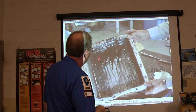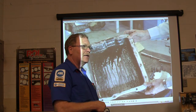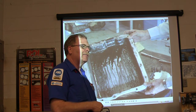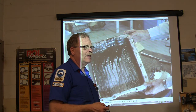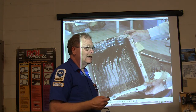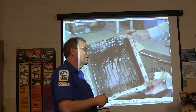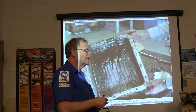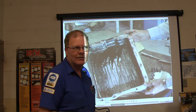This is what it looks like when you pull the transmission oil pan off and it's full of material. Whenever you see this, it's bad news. Some people say that if you service a transmission that's been driven 120,000 miles and never serviced, that brand new fluid can break varnish and crud loose inside the transmission and cause valves to stick — you can actually cause a problem by servicing a neglected transmission.